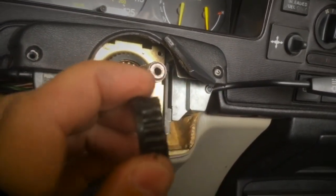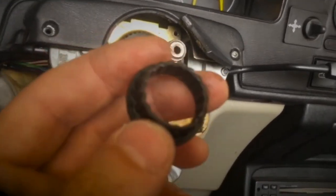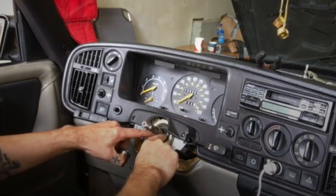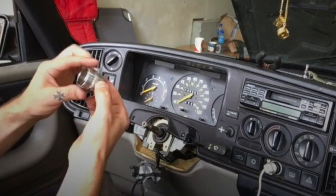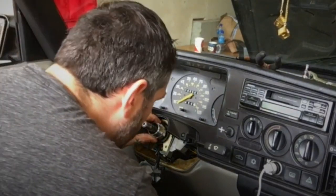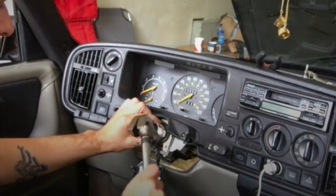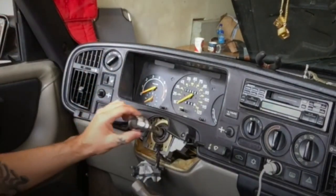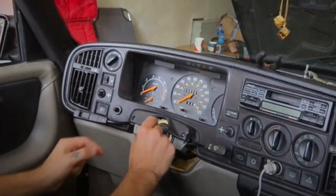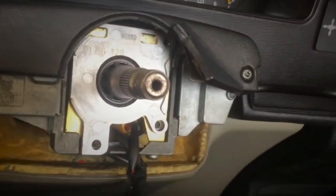I'm going to put a new one in. I've put the new bushing on where it's supposed to go — you can immediately see now that the steering is absolutely solid compared to before. Then I use this tool — it's a plumbing tool but it happens to be around the same circumference as the bushing — and I lightly tap with a hammer to make sure it's gone completely flush. I'll repeat that process when I put the lock ring on. Here's our new lock ring — that goes over and I do the same process of tapping it into place. I've reinstalled the backing plate using a new one because the tabs broke on the old one.